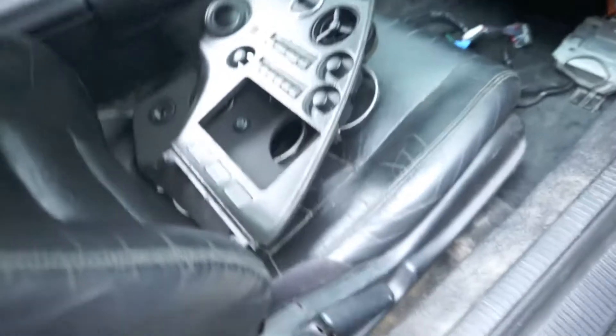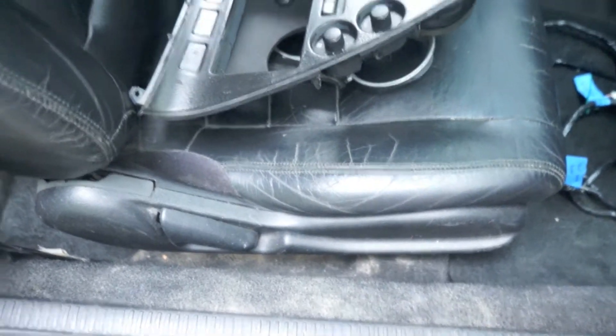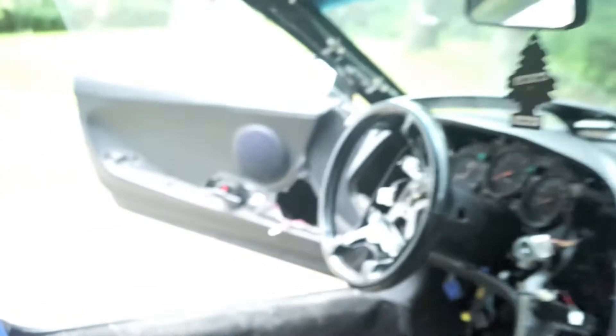I found a mess of wires underneath the carpet — just audio wires — and I cut all of that out and removed the panels. I also cut the ABS speed sensor wires, what was left of them. Since I don't have ABS anymore, there's no point keeping those wires there. I've got all the wires out of the way for the seat delete kit coming in the mail. I also have the other carpet retainer trim piece for the other side coming in, along with a speaker pod since I'm missing that — I have it on one side but not the other.